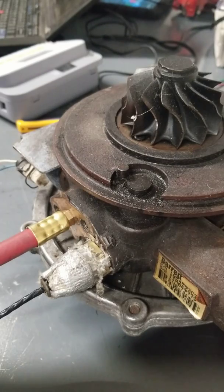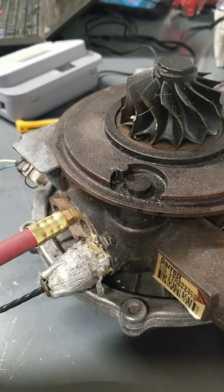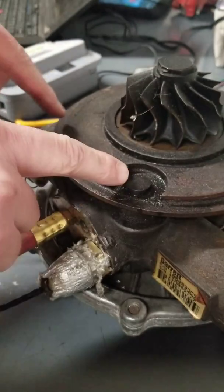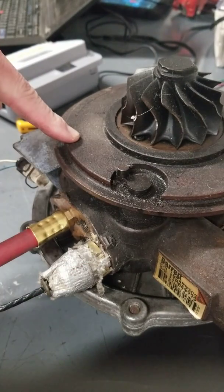To make this work, you've got to take the Duramax sensor — there's an allen bolt here, just unthread it, threads right in. Once you have that and the truck's running, the controller is actually going to calibrate it, so it's going to move this knob back and forth to measure the sensor voltage, and that's going to give you your 0-100% value.